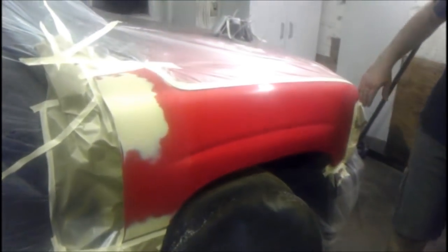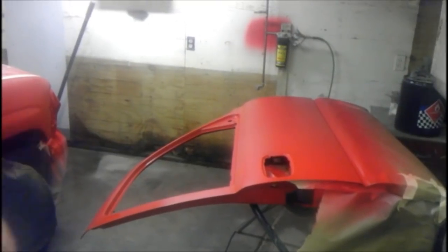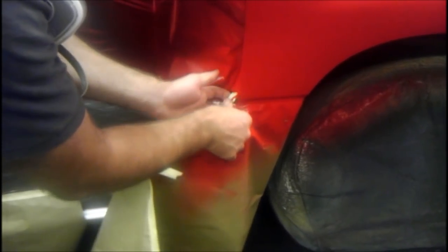I'm not going to paint the whole fender — I'll just blend the red up to here. Same thing on the door, I'll just blend it to the top. It's going to be all clear coated. We've got the red color done. Now I'm going to let it flash for about 30 to 40 minutes before the clear coat. But before the clear coat — and this is my secret — I open both colors, red and gray. You can see how nice and beautiful the line is.